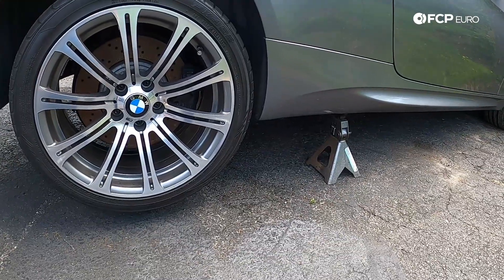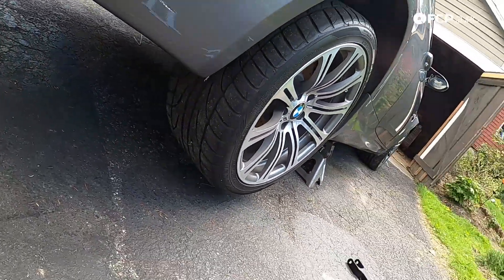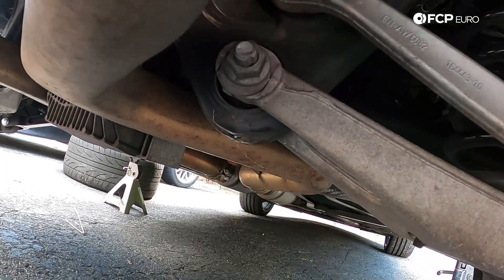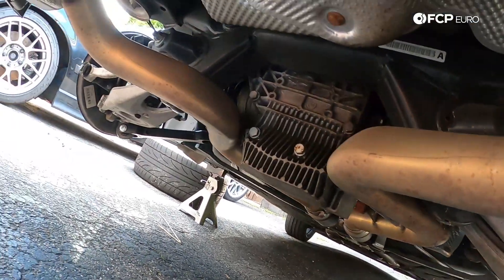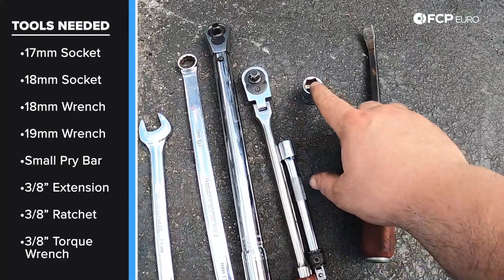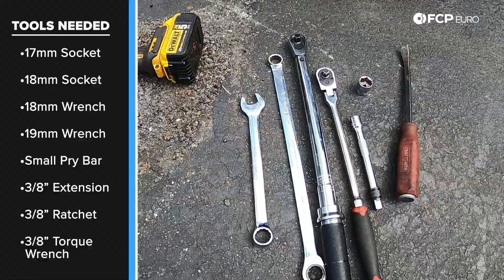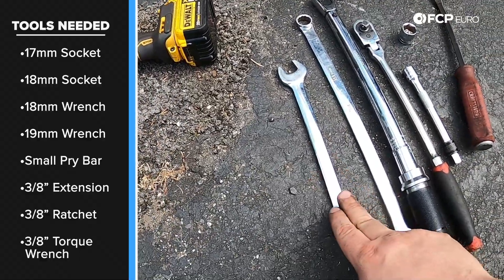First, before anything, you want to make sure that the vehicle is properly supported on jack stands — have it done on both sides. When I raise the rear of most of these cars with a floor jack, I will actually raise it right off of this little hump here for the lower control arm or the spring arm or camber strut, whatever you like to call it. This is a really good lifting point and it's mirrored on both sides. I always try to lift from this point as opposed to going from the diff, and it's very easy to slide the jack stands under if you lift from here. There's not really that many tools required for this job: a little pry bar, 18-millimeter socket, 3/8 extension, 3/8 ratchet, 3/8 torque wrench to torque the bolts to 100 Newton meters, which is factory spec, a really long 18-millimeter wrench — although a normal 18-millimeter wrench would work perfectly fine — and a 19-millimeter wrench as well.